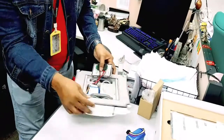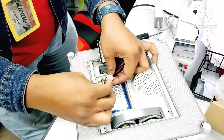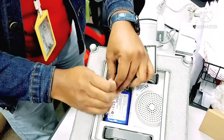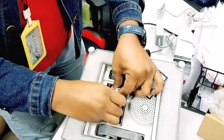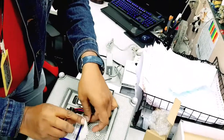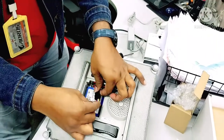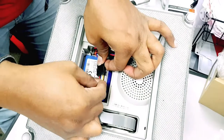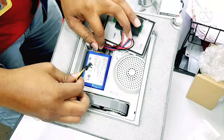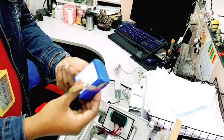Remove the cover like this and take out the wire. This wire is covered with very hard tape for protection, so the wires won't contact each other. There is a clip here — just pull up, press to unlock, and remove the clip. Then put your finger here, pull up the wire, and the old battery comes out.